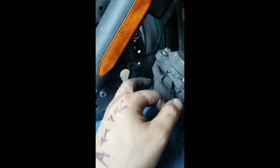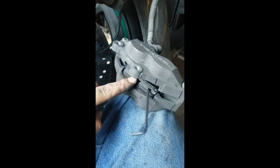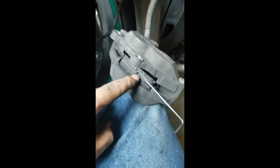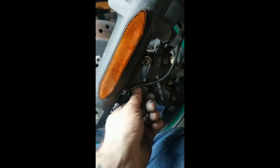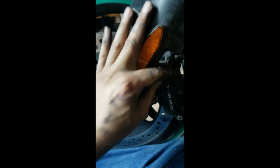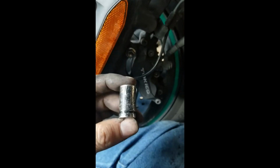But you're going to want to open those up. The rotor will go in between the two. Of course, I'll have to put you back down for this. Okay, 2 caliper mounting bolts going in. Of course, I forgot to mention, but you'll have found out by now, it was a 12 millimeter. Oh, come on, 12 millimeter.